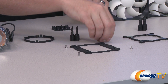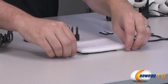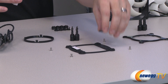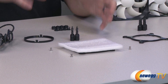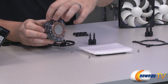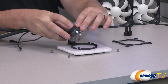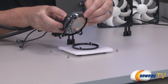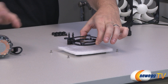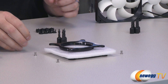You have thumb screws that you will attach there. For demonstration, I'm using a piece of foam to simulate a motherboard. Once you have the backplate attached to the back of the motherboard using the included adhesive strips, you go ahead and mount the water block. The water block has a protective plastic on it that you want to remove. It has teeth all around the outside, so you put the ring on first, then the water block goes on top, and the bracket gets punched through and twisted to the sides so the teeth engage. The retention ring on the bottom snaps onto the bracket, holding the water block between them, and then you use the screws to mount down through into the threading on the metal grommets.